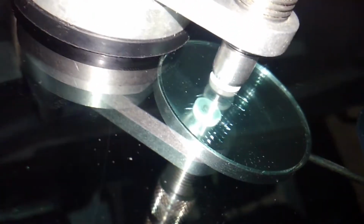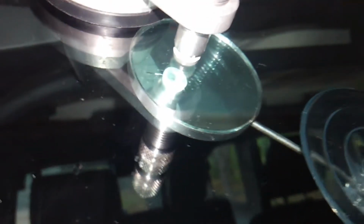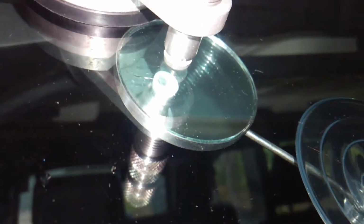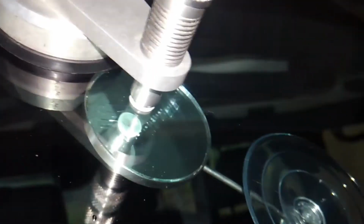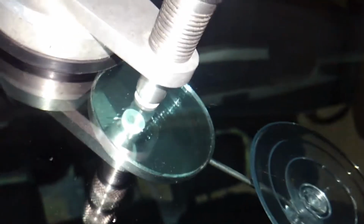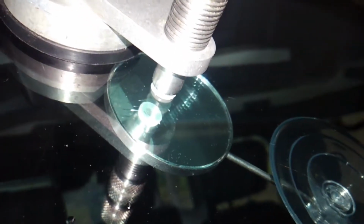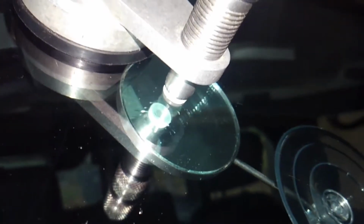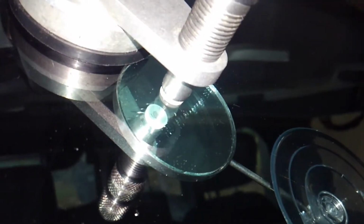Alright, now we have the resin under pressure. I'm going to see if we can get an angle on it to watch the resin flow into the cracked glass. Those little lines coming from it, that star break, it'll actually start to diminish those lines. It'll be much more difficult to see the damage once the resin flows through the crack. So I was trying to catch that in real time, but because we're in a dark area, it is difficult. So I'll pause it here. We're going to give it a good 5-10 minutes to flow through the crack, and then we'll start on the next step.